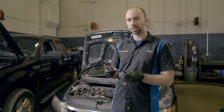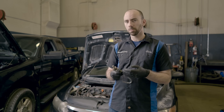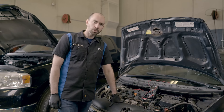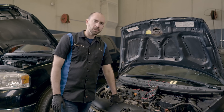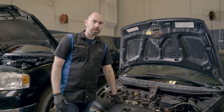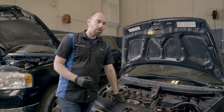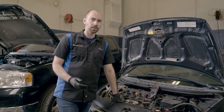We've finished our brief visual inspection — our wiring and sensors looked good and we didn't see anything obvious. Now we're going to move on to the O2 sensor heater circuit. Your vehicle's fuel system can run either open or closed loop. Open loop means it's using a pre-programmed amount of fuel with default values programmed at the factory. Closed loop, on the other hand, means it's using feedback from your O2 sensors to make decisions about how much fuel to inject.